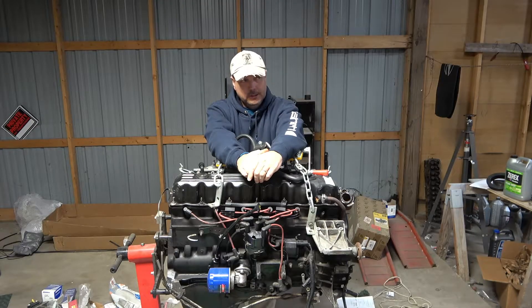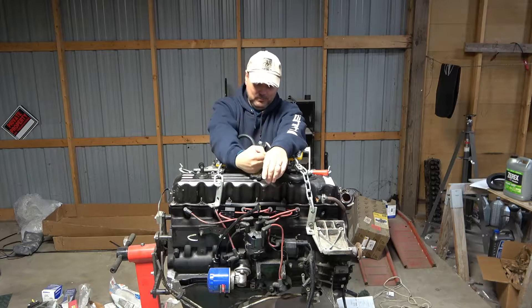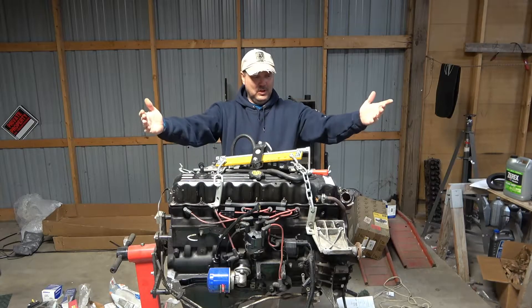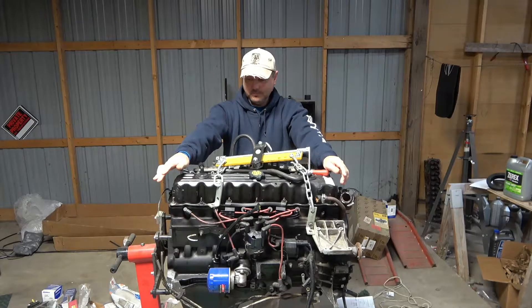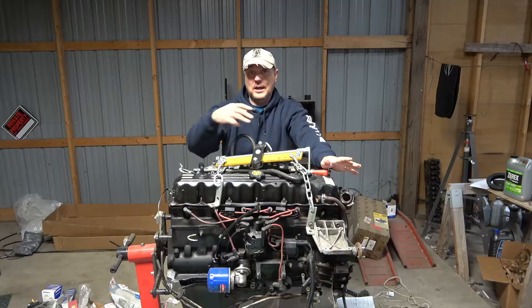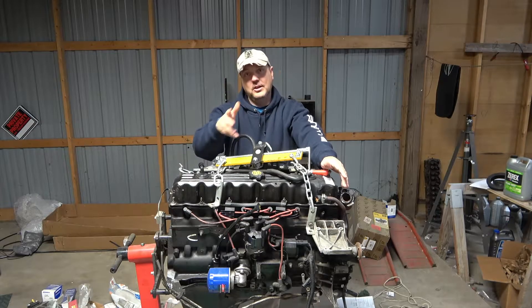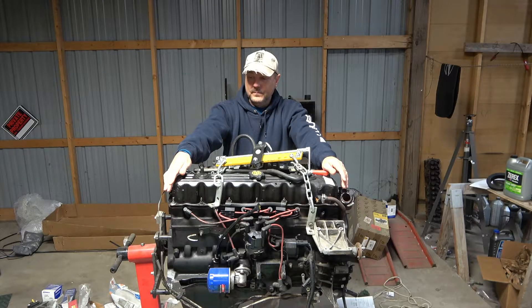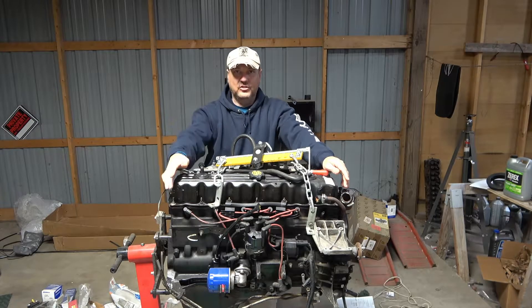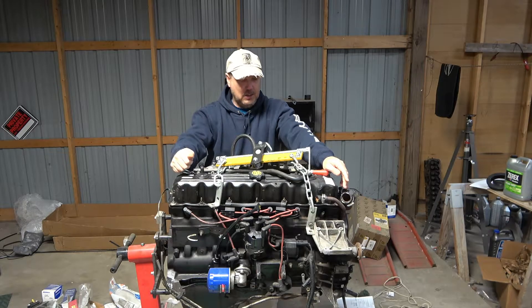Already started to order parts — we'll document that as we go when parts come in. We're going to start our engine rebuild series. This is the first video of that series for the 4.7 stroker. The base we're going to use is a 4-liter out of a 1996 Jeep Cherokee, so it's an NVH block — it's got stiffer webbing in it and has a crank girdle. You all will see all that when we disassemble this motor.